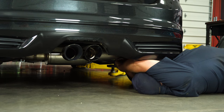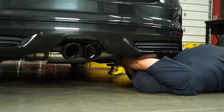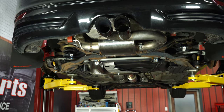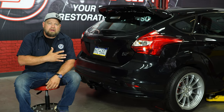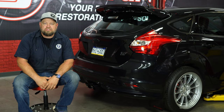For the rear, we did put it in the second hole — the one that's closest in — which makes it a little bit tighter. Brennan's making the final adjustments; we're going to tighten down the end links, get the preload that we want, and our installation is finished. Because we did unbolt the front subframe, you do want to make sure you get the car aligned or at least check your alignment before you drive it. Our Whiteline adjustable sway bar kit is going to take a car that already handles great and make it handle even better. By getting rid of body roll, it allows us to put the power down a lot better, plus the adjustability allows for modifications down the road. The front is time consuming — figure about three to four hours — but you'll be back on the road in no time.